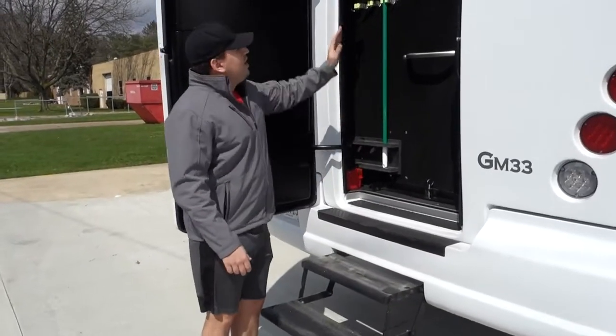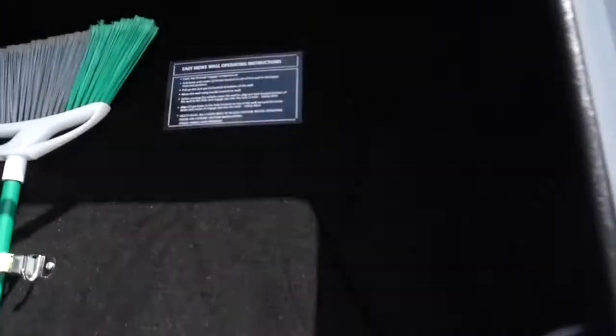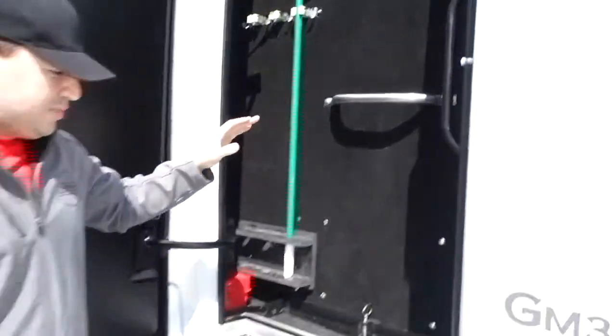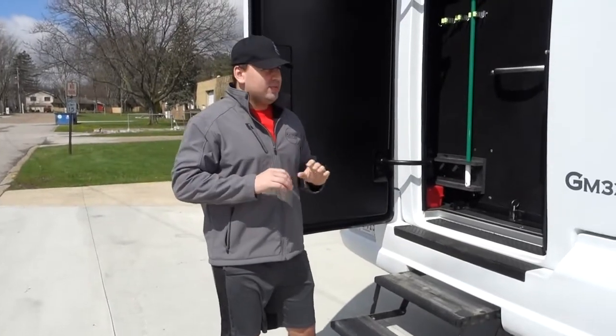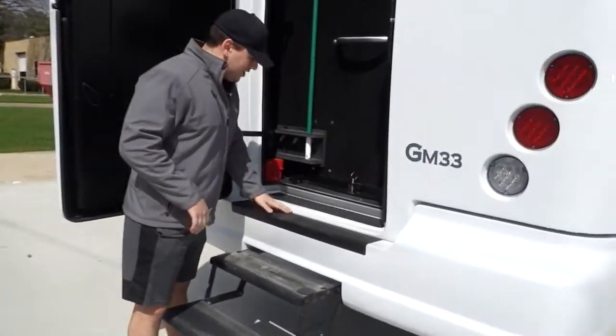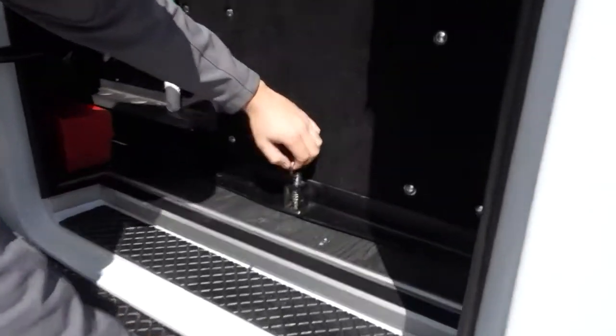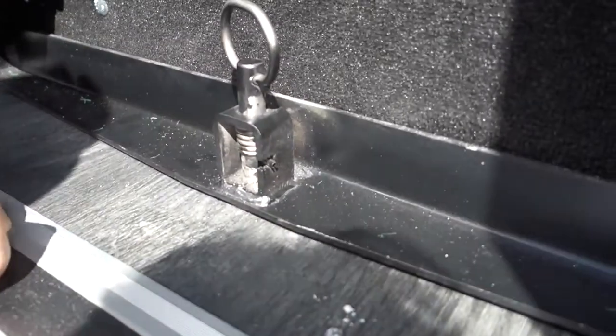So, as always, you have your easy movable wall operating instructions. You can check it out there. It's always there in Grech buses. It comes standard. Grech makes these buses dummy proof. Really can't, you know, say enough about the product. So you'll come here, the main security pin. Anyone can lift it, it takes no strength. Pull up, twist to the side, lock it in place in the little indent.